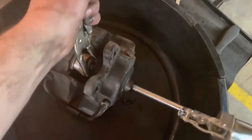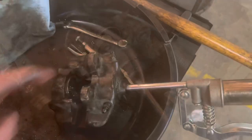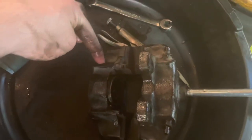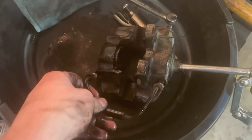Similar thing here with the piston — it needs to be pulled out, and you're dealing with two on these rather than just one. What I've done here is take the bleeders and put them both on the inside of the caliper. That way it is a closed circuit and I can pop off the inside piston without putting any hydraulic fluid or grease into the other side, so both can be removed at once.